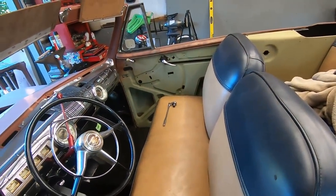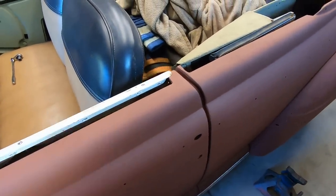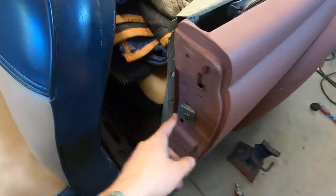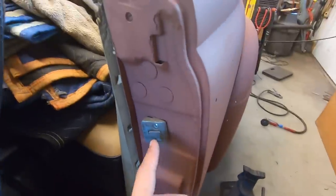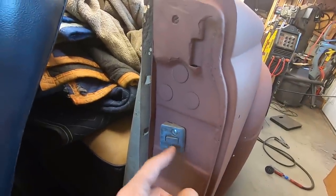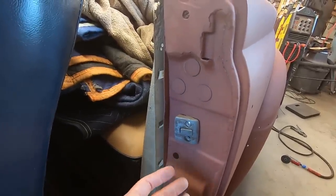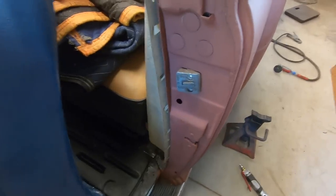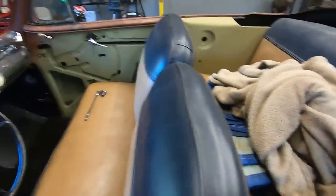What else? If I didn't show you guys already, door shuts. I only have one of these convertible door catches, and it's only held on by one bolt right now. It's barely on there. The convertible ones, the bolts go this way on them, and normally they go this way, so you can't use the set of other ones I have from a 30s car, because they'd be facing the wrong way, like flipped up. So you gotta use convertible only. It kind of sucks, it's weird why they went with this design rather than the normal. I don't know. You saw the seats in.